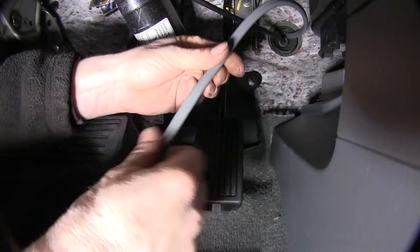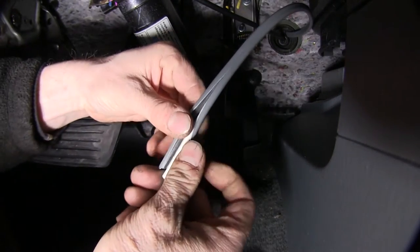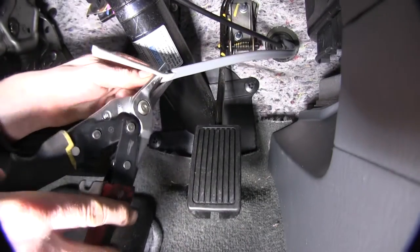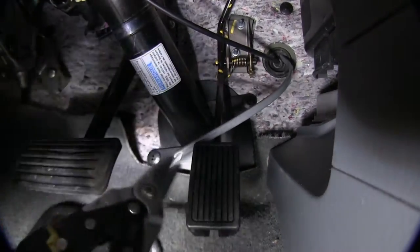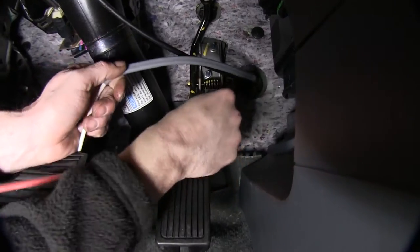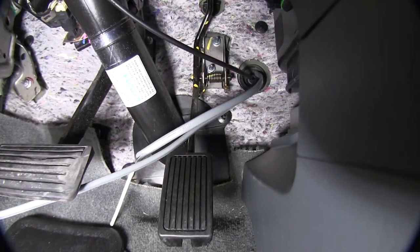With the wire we have now, we only need the white wire. We'll strip back the sheath to get to our white wire and cut our black wire short, since that half doesn't go anywhere anymore. This white wire will be our output from our brake controller. We'll run the rest of the cable back through the grommet and up to our circuit breakers.